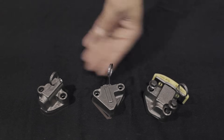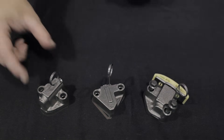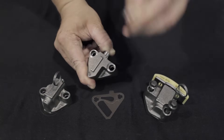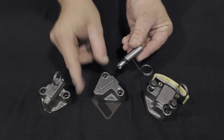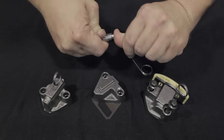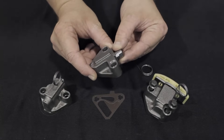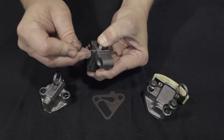The tensioners are shipped in the deactivated state with the activation pins installed. They must be installed in this deactivated state or damage will occur. In the event of installing a tensioner that has already been activated, you must go through the deactivation procedure. To deactivate an activated tensioner, remove the piston assembly from the tensioner housing and compress and turn clockwise on the ratcheting cage mechanism until it stops. Then reinsert the piston assembly into the housing, compress, and insert the pin.